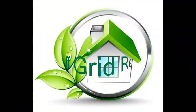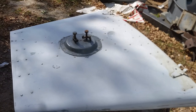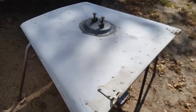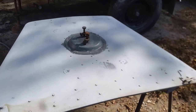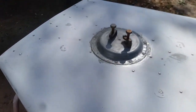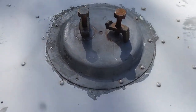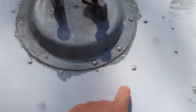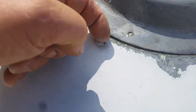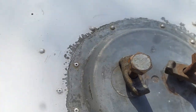Making a video about paint prep is a bit of a challenge because it's so hard to see what needs to be seen on a small screen, so I'll just keep you up with the progress. What I'm doing with the bonnet is I've applied paint stripper to the galvanized area here — when it was painted that was just blown over with no masking, paint right up to the edge. That's all been cleaned off. I've applied paint stripper around the edges here too because there's flaky paint all the way around, so I'm getting in and cleaning that right back to bare metal and feathering it in.